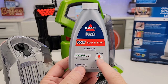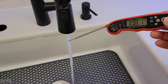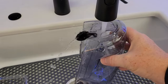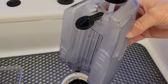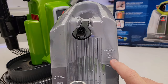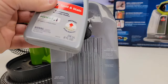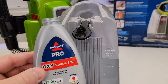We're going to be using this formula that's for portable carpet cleaners. I've let my tap water run a little bit and I've got about 140 to 142 degrees for my hot tap water — so be careful, but this is what you're going to put in the machine. We're going to fill it up to the water line, then go from the water line to that line with formula. At this point you could add another ounce of boost, but I'm just going to use the spot and stain remover.